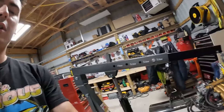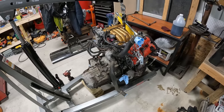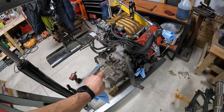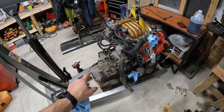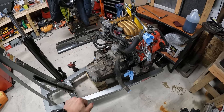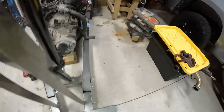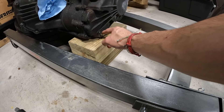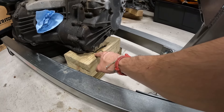What's up guys, welcome back to the channel. Previously you just saw me pull the complete motor and trans out of the car. One of the reasons I originally pulled it out is because I needed to do some transmission work. It does have a reverse gear grind, so there's something going on internally. I noticed this when I drained the fluid - the drain plug on the transmission had quite a bit of glittery substance in there, which leads me to believe there's some type of metal on metal contact.